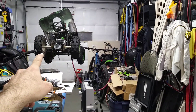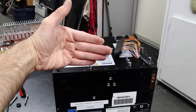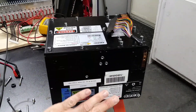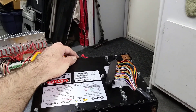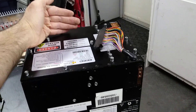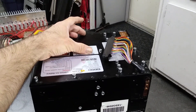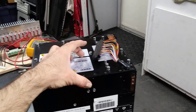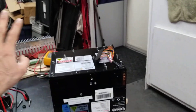So I will split the voltage in half. It's 28 cells — the pouches are sandwiched between thick aluminum plates, about 3/16 inch thick, and there are 28 of them. My plan is to separate the first 14 cells and the second 14 cells into two independent halves, then parallel them to get 14S, or about 51.8 volts.